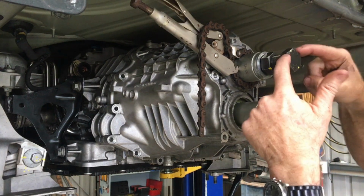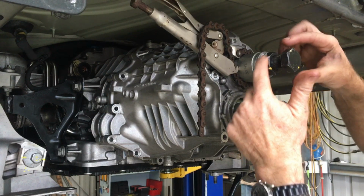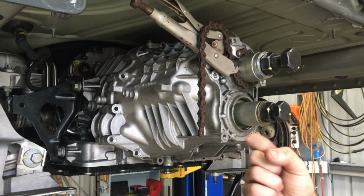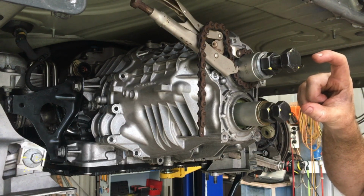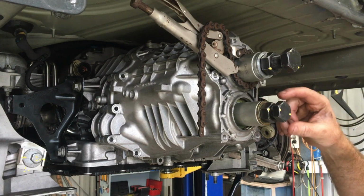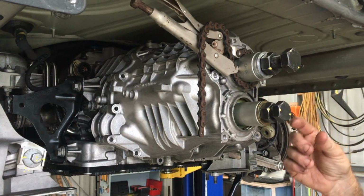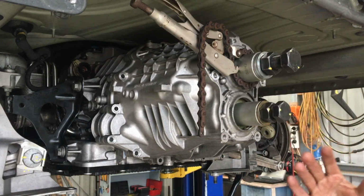And when I'm putting these on, I put some marks here at 180 degrees, so when I was turning these on, I would turn it, because even though they're different width bolts, they are the same thread pitch of 1.5 millimeters, so half a turn is 3/4 of a millimeter. So I was doing them half a turn each at a time to pull them in evenly, saving just trying to guess it.